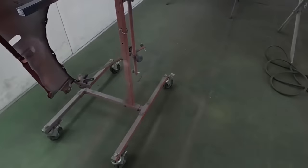I would also advise three coats for anyone spraying in their garage because you're gonna have a lot of wet sanding and buffing. Now, most clear coats will say 2 to 3 coats until film build is reached. And for you guys in your garage, and even for us with all these layers of paint, three coats is what we chose to go with. And the reason being is because you're gonna remove some of that clear when it comes to sanding.